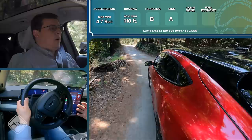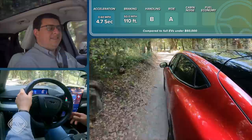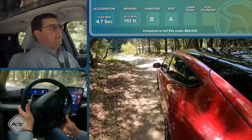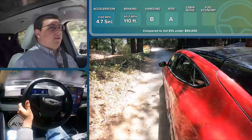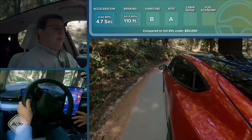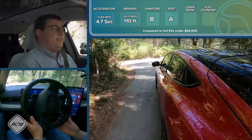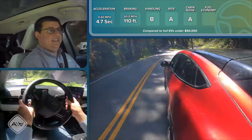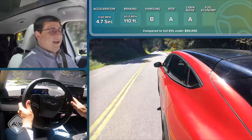As for ride quality, I'd put this below the average mainstream compact crossover but pretty on par with Tesla and the rest of the EV set. The best way to describe ride quality in many modern EVs is firm and bouncy, due to tire choice and higher inflation pressures — these tires are set to 39 PSI from the factory on 225-width rubber. In my cabin noise test at 50 mph I got 71 decibels, which earns an A, substantially similar to other EVs. The big thick battery between the road and the cabin does a good job soaking up road noise.